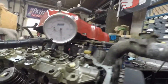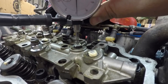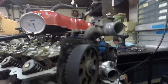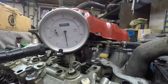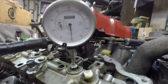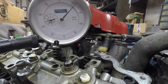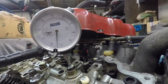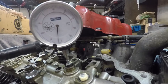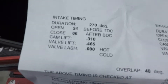To do that, we're currently at our lowest lifter height here. This is the intake lifter — this is what we're going with, and this is why I don't like this thing because it wiggles a little bit too much. I'm going to take and rotate it in the normal direction and we'll see just how much we wind up getting. Once this thing comes around with the intake stroke — there's exhaust, there it comes. There's one rotation, there's two rotations. On the third rotation we'll come up and peak at about 307, I think it was — the highest it got. Our height spec is 310 for lift, so not far off. That's not bad.